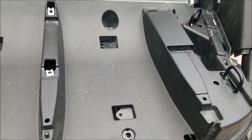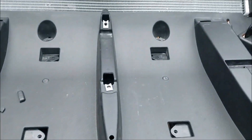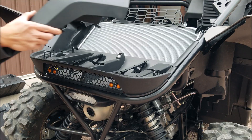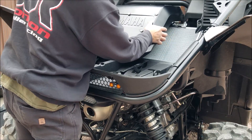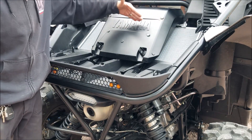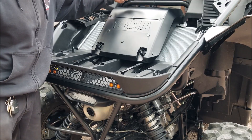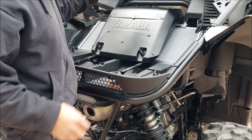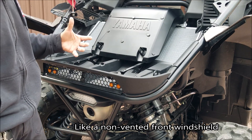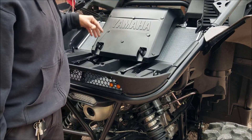Removing these plastics is pretty easy — there are a lot of bolts but they're easy to get to, and with a power wrench you can get this off in about five minutes. There's a divider here, so there's intake cooling here and intake cooling coming in from the front. If for some reason there's a little pressure here and it can't suck in air, it pulls it from the back, and vice versa. But it's not optimal.